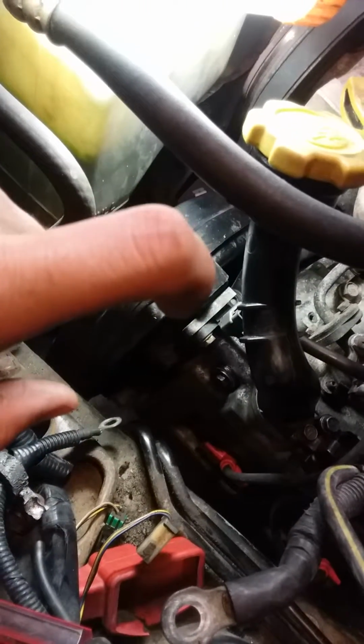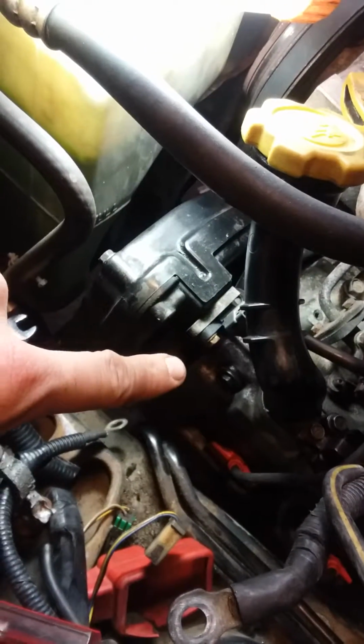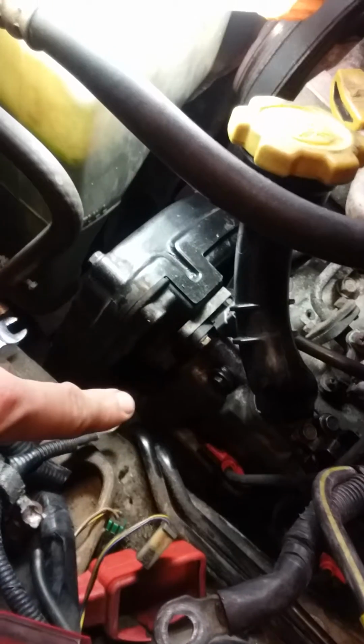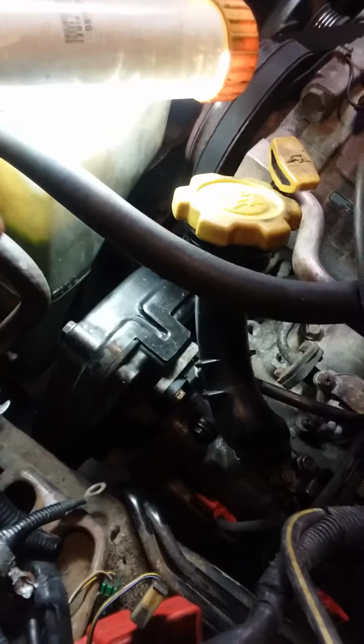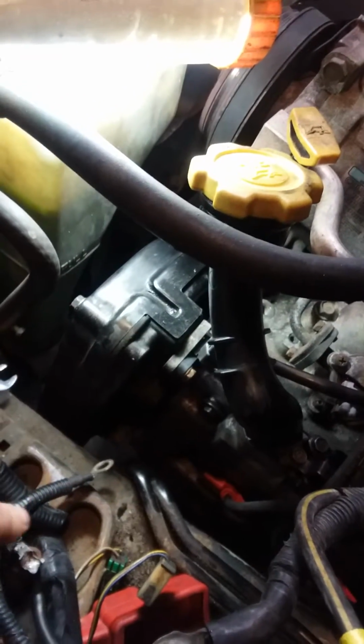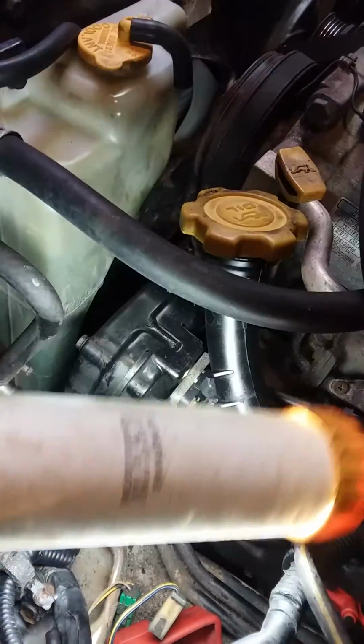There's caps underneath all of this that secure the camshafts, and they're kind of like half spheres that go over the camshafts. You want to put a little dab of Ultra Gray on both sides, on both of them. So 4 dabs on this side. I've seen people do it differently, where they run a whole bead all the way down. I honestly don't foresee there being any issue with just doing 1 dab at each corner.